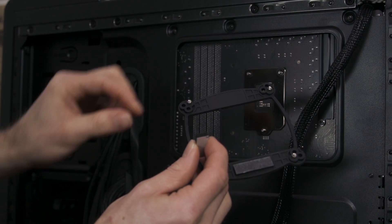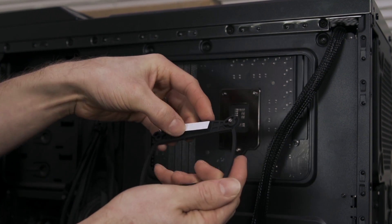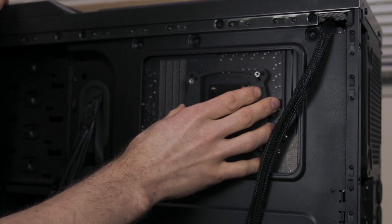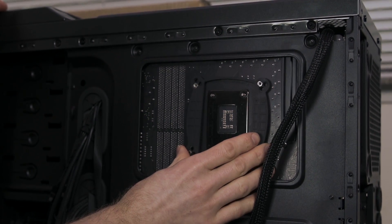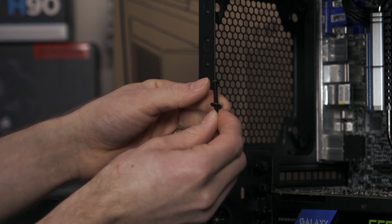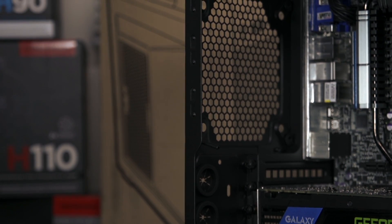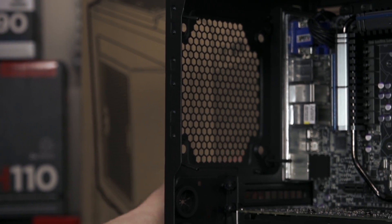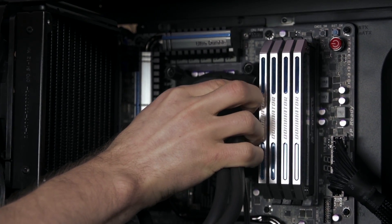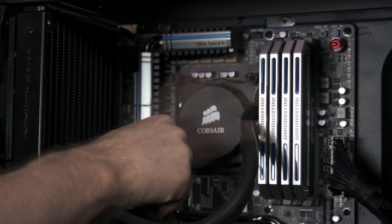The back plate can be held in place while you're installing the cooler by removing the protective covering on the adhesive strips, placing them on the back of the back plate, and then positioning the back plate on the motherboard with the pegs sticking through the holes. Mounting the radiator can be a little tricky, but the screws have washers that are optional. Because this case has rubber grommets in the 140mm mounting holes, we won't be using the washers. The flexible tubing on the H90 allows it to be easily positioned correctly directly over the CPU. Line up the screws and hand-tighten them first before using a screwdriver to tighten them all the way.